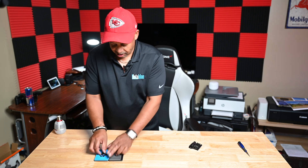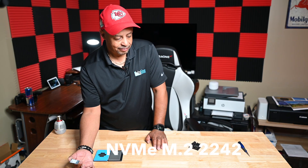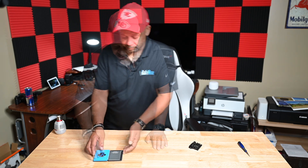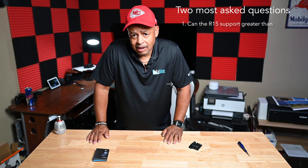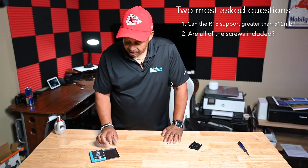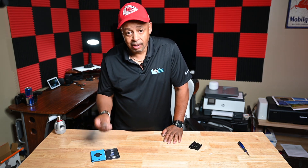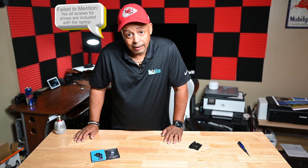If you look at this drive, this one is very small. A couple of questions that people have asked me about these drives: Dell says there's a 512 gigabyte limit on their 2242 drive. This is a 1TB, so we're about to find out. I'm almost positive it'll work, but we'll find out. If not, I'll send it right back and get a 512.